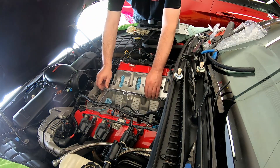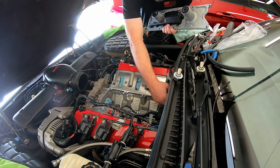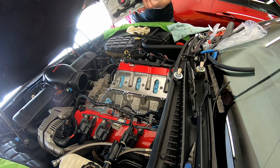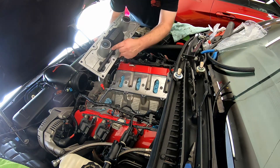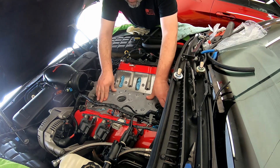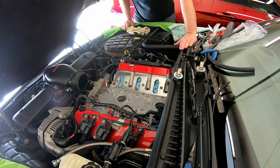New gasket - just going to set him into place. Put just a smidge of oil on the rubber seals for the knock sensors. This box is what makes this whole magic happen, and this passageway right here is what we had to make clearance for on the block. I'd say we are in fact good to go. Don't let me forget to take those rags out - that would be incredibly stupid. Give it one last little cleaning before I bolt this on.